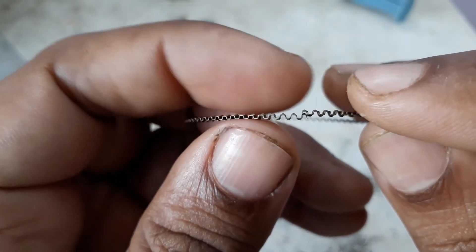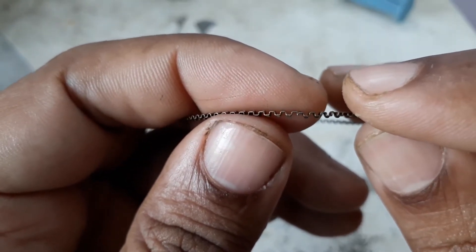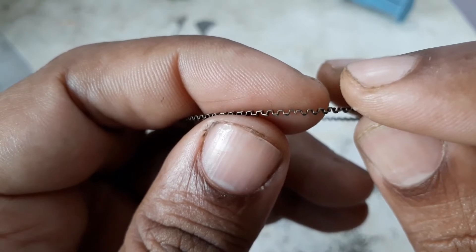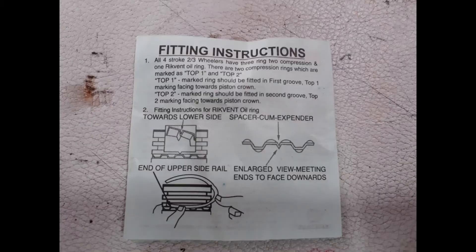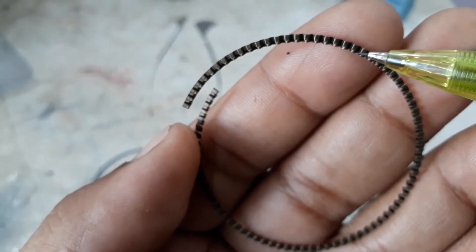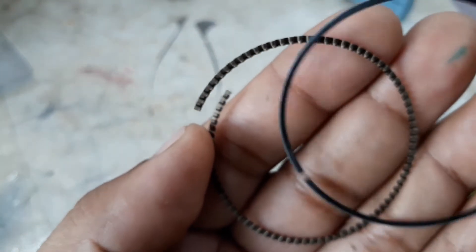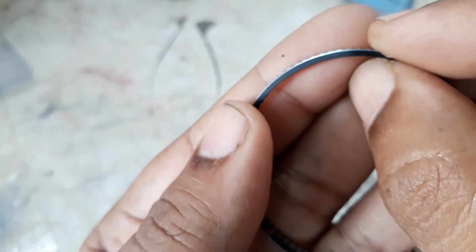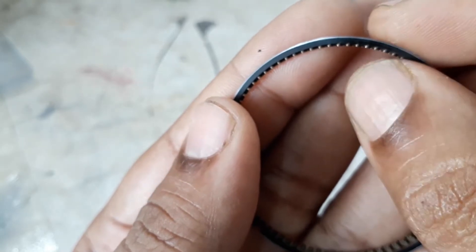You don't have to put rings one upon another, otherwise the whole ring will get jammed and your engine will start producing white smoke. You have to place the spacer like this. If you look at the spacer ring you can see small elevations — when you put the oil ring here, it should come like this, and not like this. It should not be installed incorrectly, otherwise the rings will get jammed.